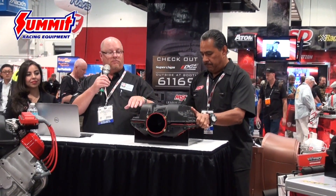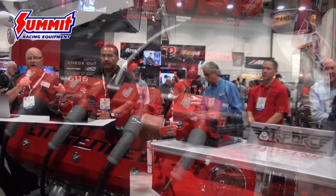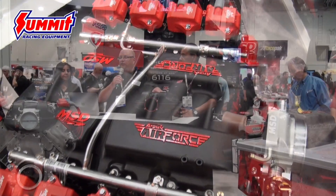So the question was: does it work? The first thing we did was run it on an LS7 at MSD on our SuperFlow SF902 dyno. We were very impressed with the results but didn't think anybody would believe us, so we needed third-party validation. We partnered with our friends at Lingenfelter — Mike Copeland and Ken Lingenfelter — and on their mild Lingenfelter LS7 with a cam and headers, we made 22 horsepower over a stock intake and 25 foot-pounds of torque, and 8 horsepower and 8 foot-pounds of torque over a ported version of the current aftermarket intake.